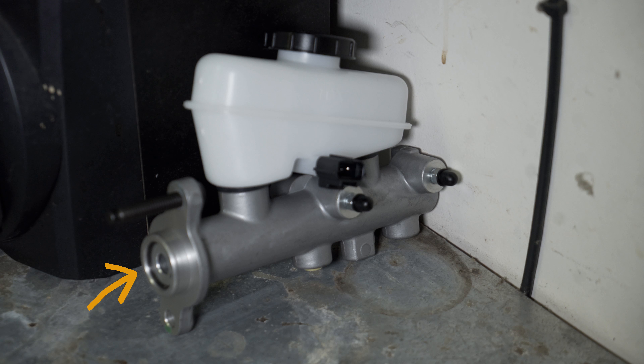When you depress the brake pedal, the booster pushes a rod — also known as a push rod — into the cylinder, which compresses the brake fluid. If you follow the pressure all the way down through the brake lines, it eventually reaches your calipers and causes your pads to squeeze the rotor, causing your car to slow down. That's a little lesson in how your brakes work.